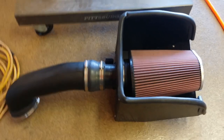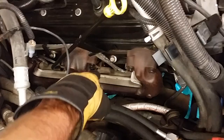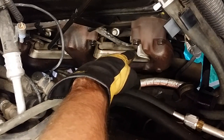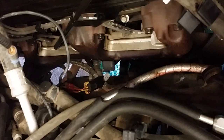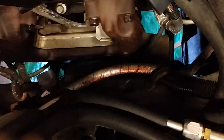Starting the passenger side now. Just removed the K&N cold air intake and here's what we've got to work with. Some of the steps involved: same thing — we're going to pull off the wire looms and the bracket holding the dipstick in. I'll tag and record each one so I know which cylinder and which wire. Pull those off, pull out the spark plugs, and it's already unbolted from the exhaust flange back there. Take off these six heads and studs — hopefully that's not a huge pain. Then from there we'll be able to see the passenger side motor mount.